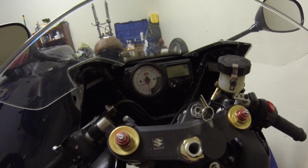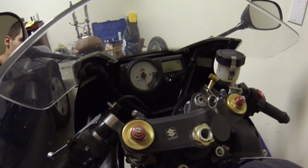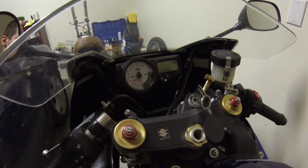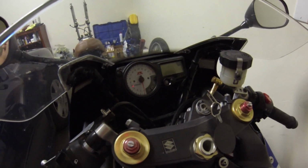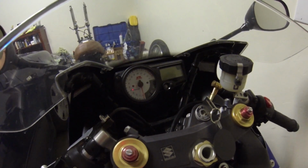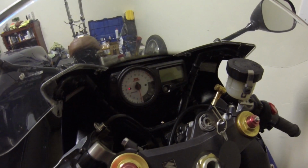If you are very inexperienced with soldering, if you don't have the right equipment, this isn't a job for you. I would recommend you get a very fine point soldering iron, lots of flux, lots of soldering wick, and most importantly, a magnifying glass or microscope.